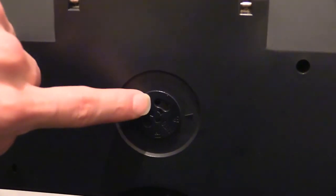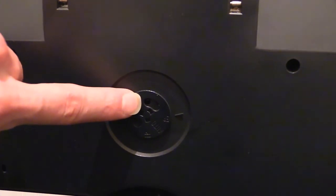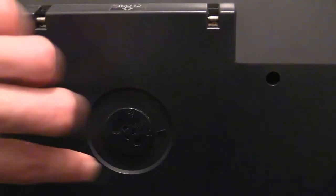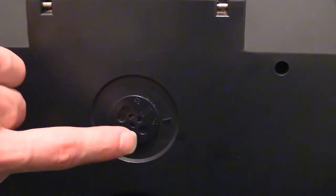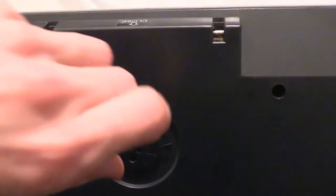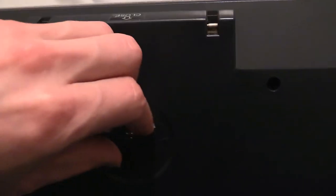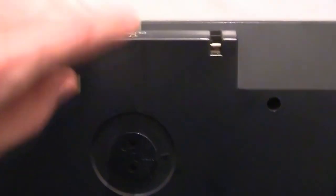Let's get back to this. With that selector set to LP, you've got to make sure you only put 12-inch records in there, not 7-inch, otherwise it will drop the needle where there isn't a record and could damage it. If you turn it the other way it blocks both sensors, and again it will assume it's a 12-inch. I'm going to leave it on auto — that way both sensors can shine their lights out and it's down to the vinyl spinner to determine what size is in there.